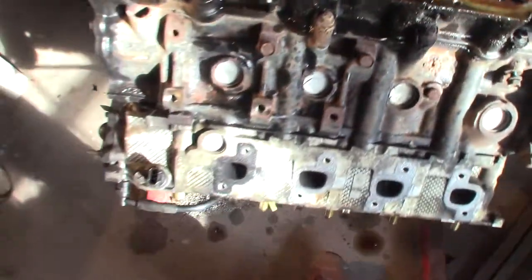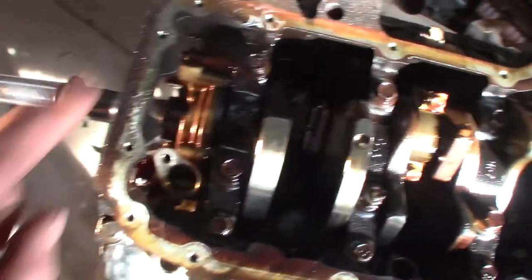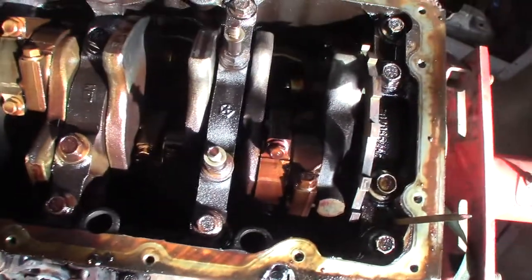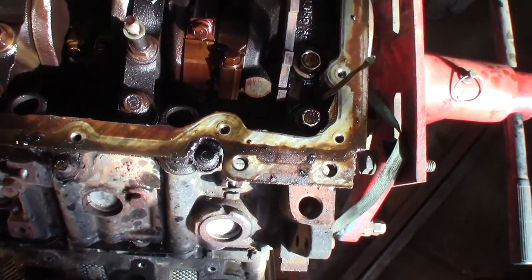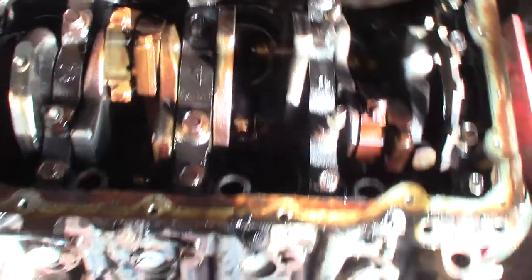On the 4.7, I've got to pull this crank out without pulling the heads and pistons and all that - otherwise it's really turning into way too much work. The oil pump has to come off. I can get most of the rod bolts but I'm going to have to turn the crank to get to some of them, which is going to be a little tricky. It looks like it's in a good position right now though.